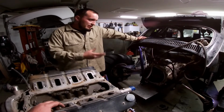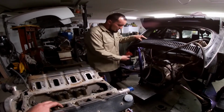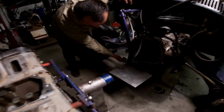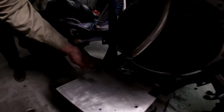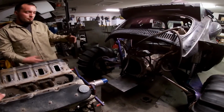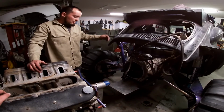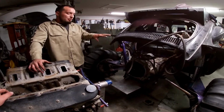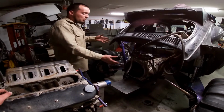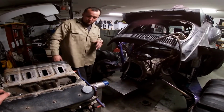They have these nice quick disconnects for the cage. These are pretty strong. They go together with Allens. If you look right here, they're actually molded so that they mate right up to each other, and there's one on all four corners. An Allen goes through the top and one through the bottom. Really strong. They use it in roll cages to hold it all together. So no big deal. They're designed to get quick access to things, so we remove that first after getting the motor unbolted.